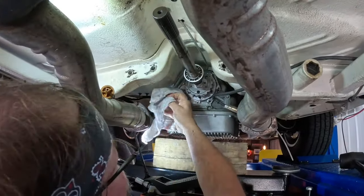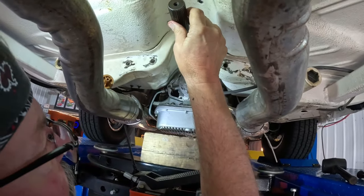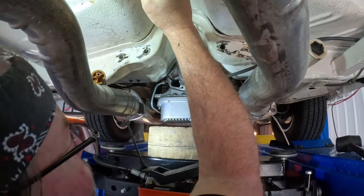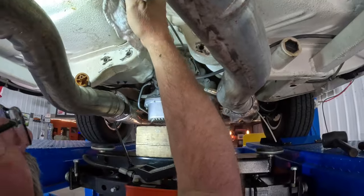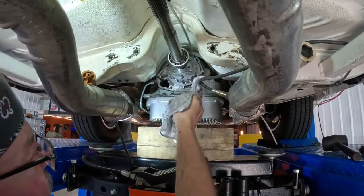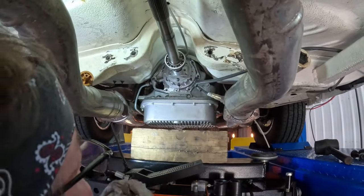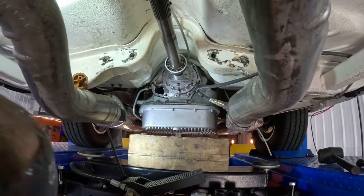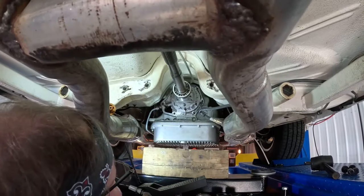I'll clean that surface off there a little bit. Now, what's the chances, Jer, that we might have bent that shaft? No, I don't think so. You wouldn't have bent the shaft. The only thing I'd be concerned with, but again, it still runs down the road, is the low sprag. Anything that could have hurt the sprag a little bit, the springs, but being a bolt-in, should be okay. Okay, I'll clean this off and I'll let you put that new one on. That works for me.